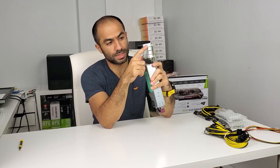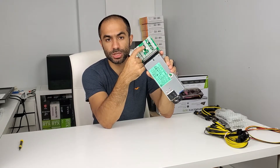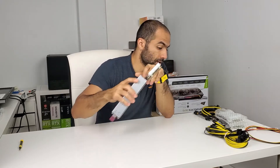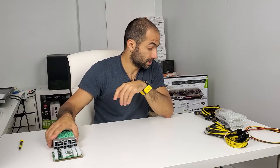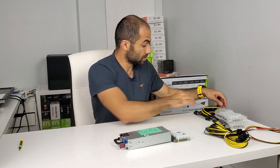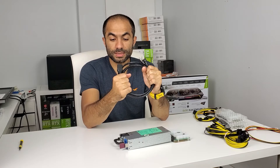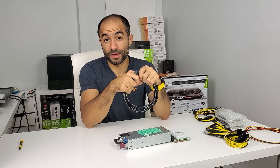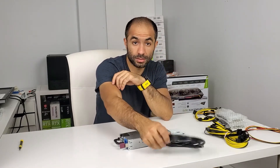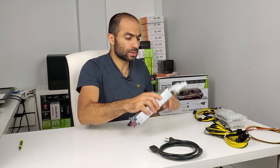In this case you power your GPUs with it — I have four times four, so 16 connectors — a power on/off button, a display that shows you the voltage and current, and a Molex power connector if that's needed. One other thing you need with your server PSU is a power cable — don't forget, they don't sell them with it. Ideally find something rated for at least 10 amps, but 15 amps would be a lot better. You can find these on Amazon and I'll put the links below.